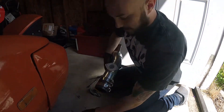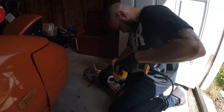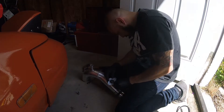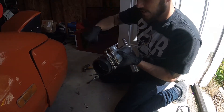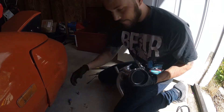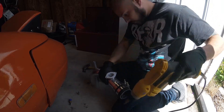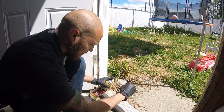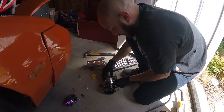Now that that's out of the way, let's see what we can do here. It's soft aluminum, so I'm hoping we can get it just close enough to where I can get this to actually thread in. Let's try to drill it a little bit more. All right, it's threaded now — it's good to go.